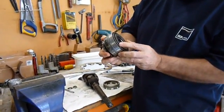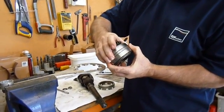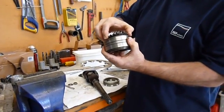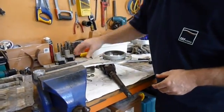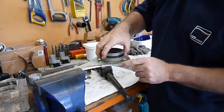What we do is we have pressed the bearings and the outer spacer, or the large spacer, onto the gear. We have pressed it on without pressing it fully on, so there is a little bit of space and they are loose. So we assemble them with the cover nut, the spacer, and there is a new seal in there and a new o-ring.